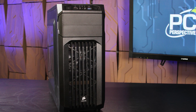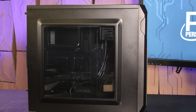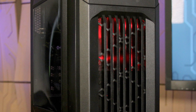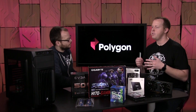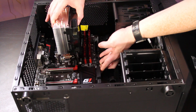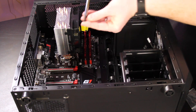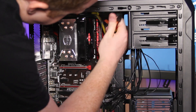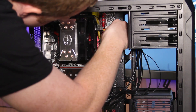For the case, it's a $52 case with a huge side window. What else about this case jumped out? It's got an LED fan in the front. If you look at Newegg or Amazon and search computer cases, there's going to be a thousand options — it's pretty much down to what you like. This particular case is big enough to build in; we were talking earlier about mini-ITX cases being very hard to work in. This won't have that problem. It's got plenty of capability for airflow, cable grommets to route things behind the motherboard, and front panel connections including USB. We picked the Corsair Spec-01 in red because of the red LED. There are lots of other options at a similar price point.